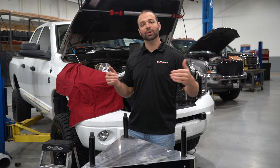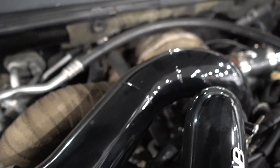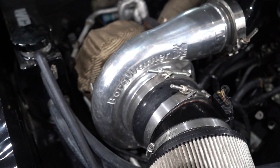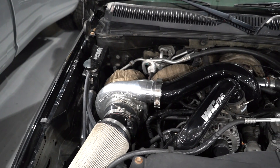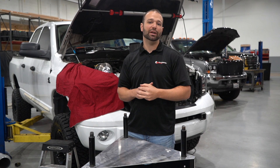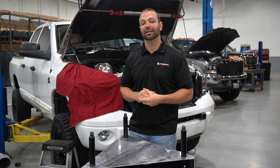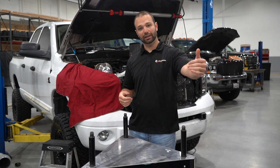The exhaust gas comes out of the head, goes into the manifold and into the secondary turbocharger — that's the small turbocharger, or the valley turbocharger on a Duramax. That's going to run that turbine, come out, go over the crossover pipe to the primary turbocharger — the large turbocharger. That turbine is driven and then the exhaust goes out the downpipe. Air is compressed starting at the primary turbocharger; the large turbocharger creates an artificial atmosphere for the secondary, forcing air into it at 20, 30, or 35 PSI instead of ambient 15 PSI. It then takes that compressed air through the system, into the intercooler, and into the engine.